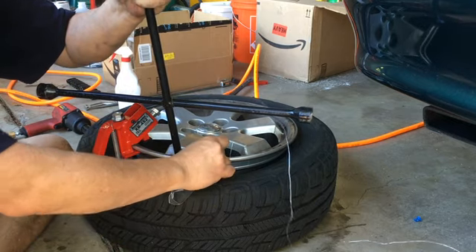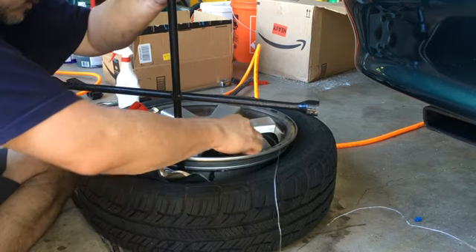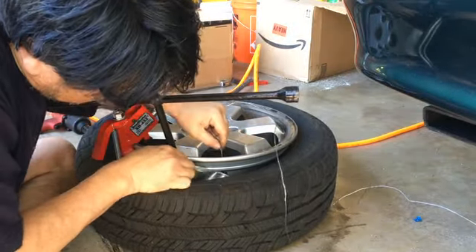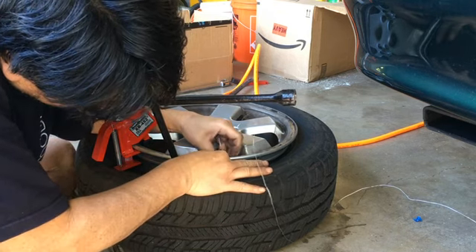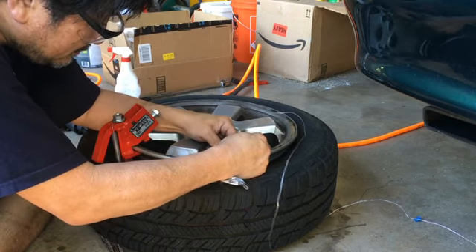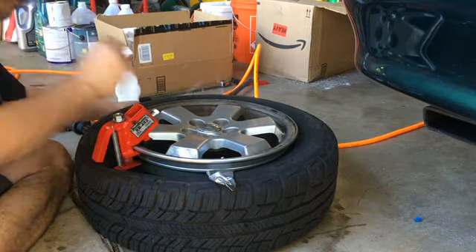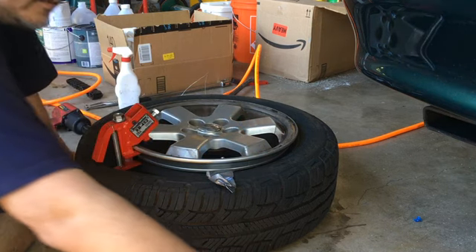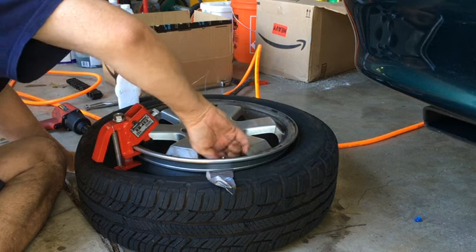The tape's sticking on itself. Now I'm pulling on the fishing wire and threading it through the rim hole. There we go, it went through. I need to somehow get this electrical tape off. There was a washer on the OEM Toyota unit so I'm going to put it back on. Here's the shaft's thread — the thread is in so I'm in safe zone, it's not going to drop inside the tire anymore.